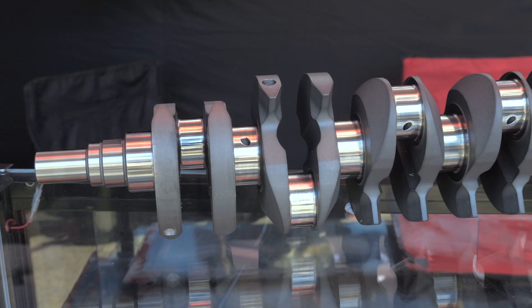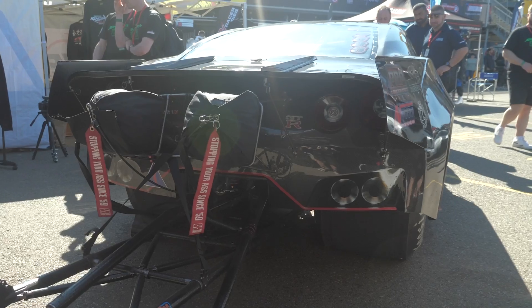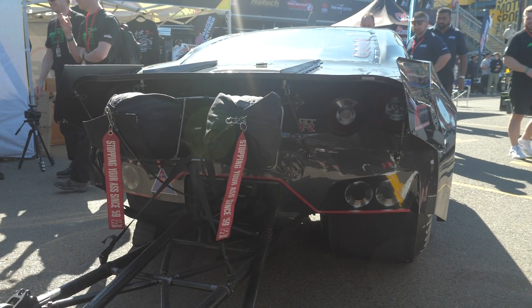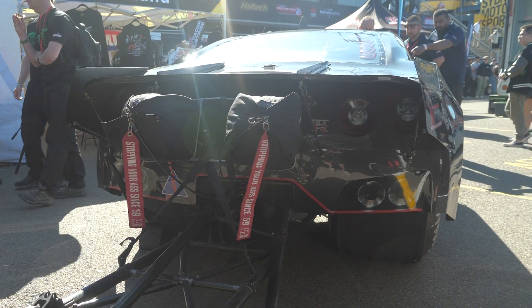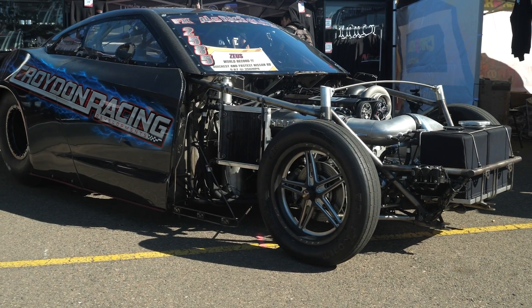In a road car, this thrust force mainly comes from the driver engaging and disengaging the clutch, which is a limited amount of force. This gets increasingly larger with higher clamping force clutches. In a drag application like Zeus behind us — which currently holds the world record for the fastest RB26 — what is increasing that thrust loading needs to be addressed.